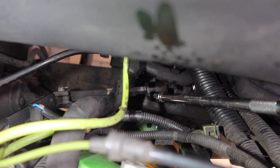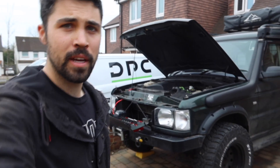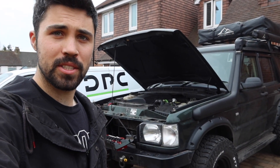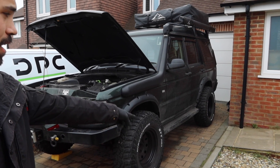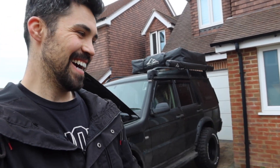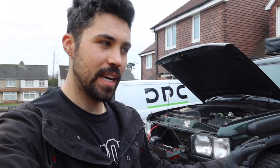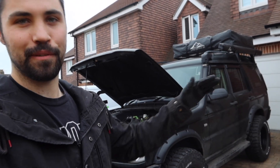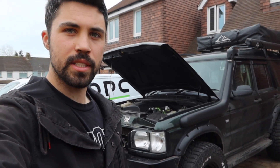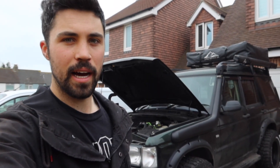So I'm about three hours in. I've got all the body bolts off and the radiator mounts are all off. Basically I'm going to start jacking up one side — I'm going to try and put the jack down here and lift just one side so it tilts about two inches, then I can put the spacers in. I've left some bolts in just to locate it so when I'm tilting it it's not going to fall off. I'm going to jack it up nice and slowly to see if any brake lines or anything are catching.